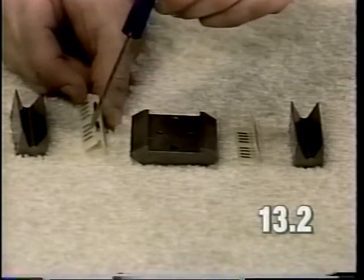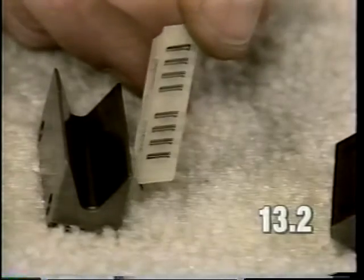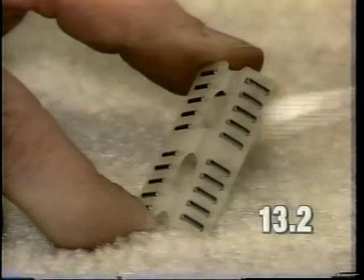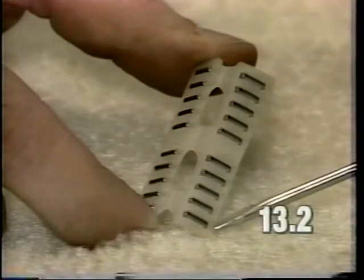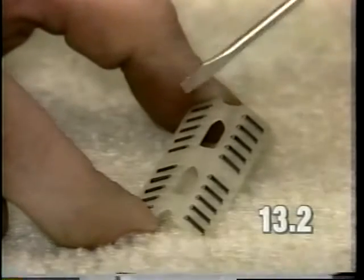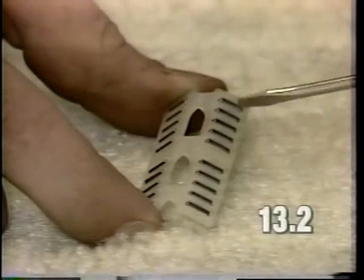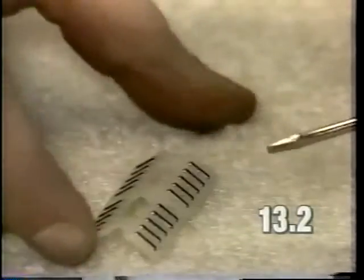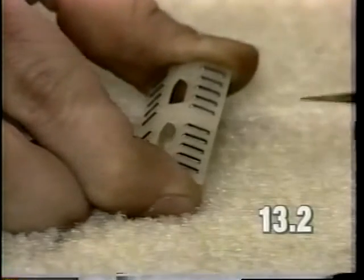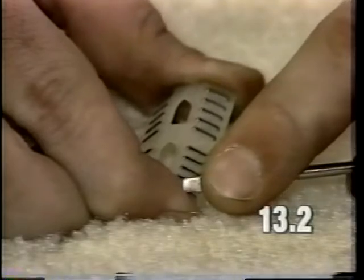Examine the roller bearing cages. Make sure that all the roller bearings are in place and that the rollers are not worn or flat spotted. Earlier model Generation 3s may contain 20 rollers in each cage. It is recommended that if you have a bearing cage with 20 rollers, that you remove the very end rollers from each cage. You will have 16 rollers remaining in each cage. To remove the rollers, simply pop them out with a flat-bladed screwdriver.